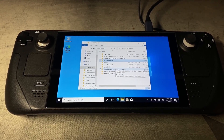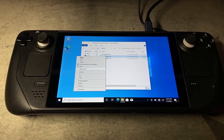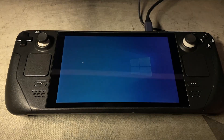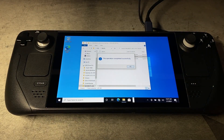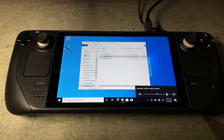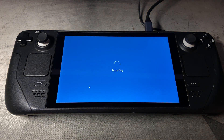And then we're going to come here to NAU, double click, go to the .inf again, right-click, go to Install, say Yes. Completed successfully. As you can hear, we've got sound now, we have Wi-Fi, and as you saw before, we had our Bluetooth running. So everything should be good to go now. And we're going to do a restart just to make sure everything takes hold.